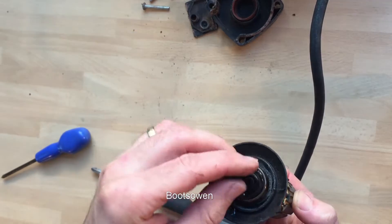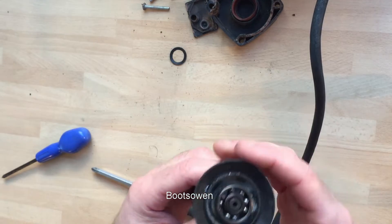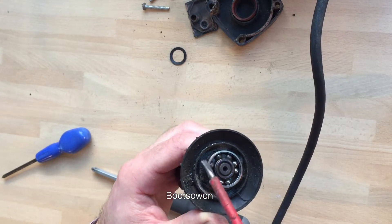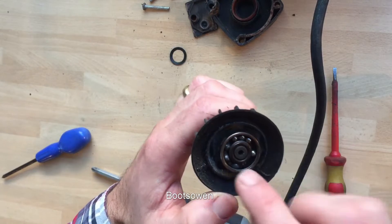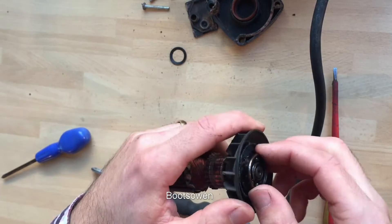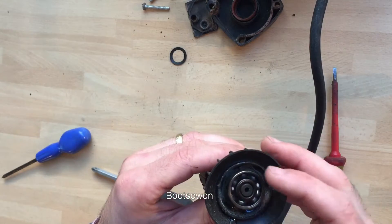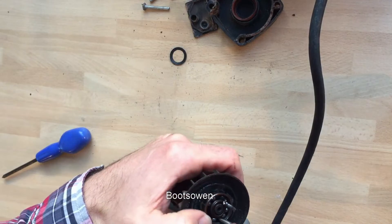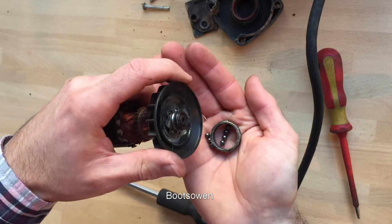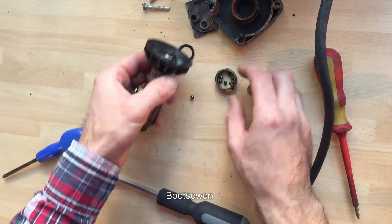This little piece of plastic fell off — it's just the bearing cover. What I tried to do was put a bit of cardboard in there and fill it with epoxy, so you can see shiny odd splodges of epoxy that I've managed to miss. You can see that the bearing races have just fallen apart and there are bearings doing their own thing. It looks like a fairly standard bearing. If we could get the bearing off, we could make up a little epoxy thing to hold the fan and put on the new bearing. By slipping all the balls to one side, we can get the outer race off — and you can see the bearing race there. The bearings were okay but a bit dry, and that race had died from overheating.